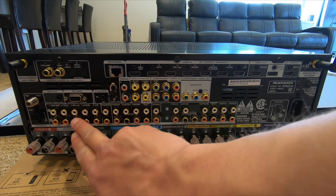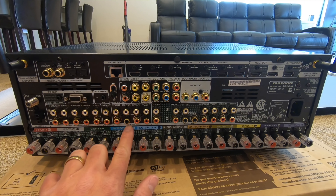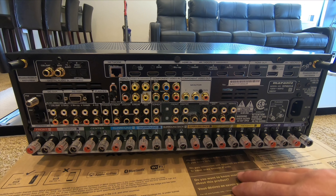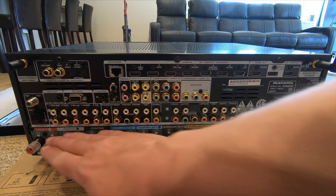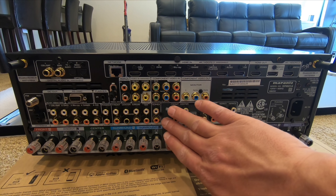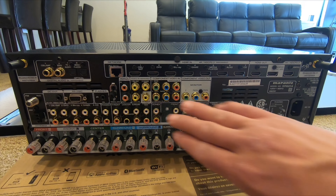All of these inputs down here are your assignable audio ins, then you have 7.1 channel in, and then these are all your pre-outs. Pre-outs are great because you can send the signal out to another two, four, five, or seven channel amp for additional power. In a lot of situations you'll see us powering the left, right, and center channels separately because those require a lot more juice. But you could do pre-outs on all your channels if you wanted.